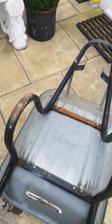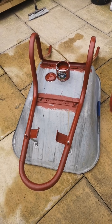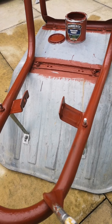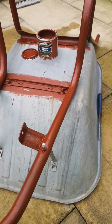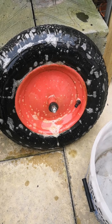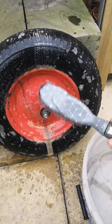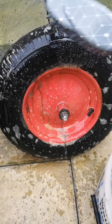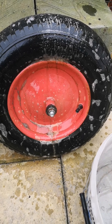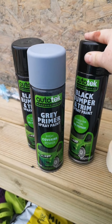On the frame I've put some red oxide primer because that's where a lot of the rust was, especially across this bar here, so hopefully that'll protect it a little bit longer. The rest of it's okay because it's galvanized steel. I'm just cleaning the tire up with some soap and water — it's not that bad really — just prepping it so I can repaint the inside of the tire.